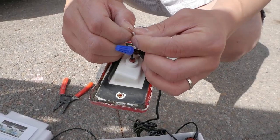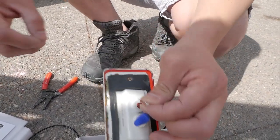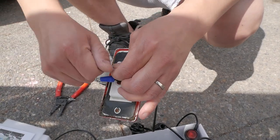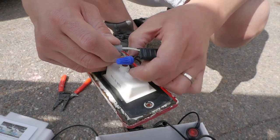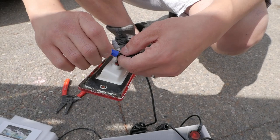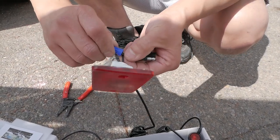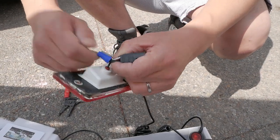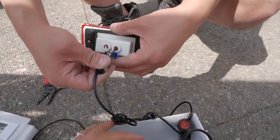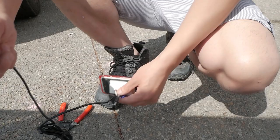Some of you might think soldering is a good idea but it's not. These lights blow all the time and if you solder it, it's gonna give you a hard time when you fix this job at a campsite. The way I'm doing it enables you to fix it anywhere — campsites, storage lots, parks, campgrounds, places where you're gonna be stuck. See how it's connected like that. I'll tape this up real good — and here's the connector for the camera right here.